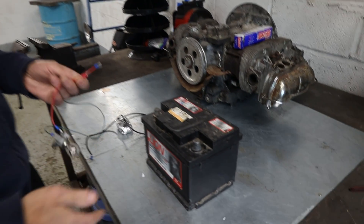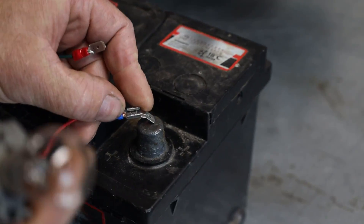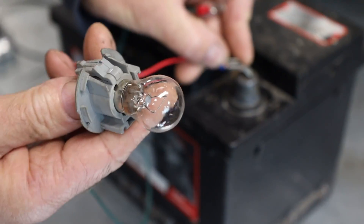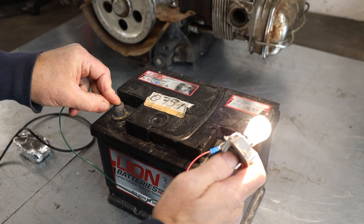This is just a systems diagram — not really a wiring diagram as yet. Let's go over to the bench. I'm going to run through some basic electrics to help you understand how to complete our diagram. We have to have a feed to our component and an earth return from our component back to our power source. So for instance, this battery here is our leisure battery. We've got our live feed going to our bulb — this could be a component such as lights, our pump, our motor for our roof vent, anything. It still has to have a live feed to it and an earth return. Our earth return we can put directly to the battery, and then our bulb lights up.